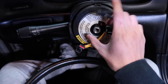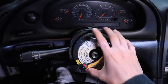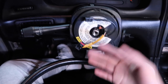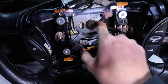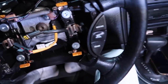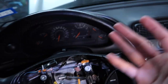To throw your new steering wheel on, same thing — pretty straightforward. Just pop it on, connect the wires, then put your airbag back on. This new wheel is already assembled so I do have to take the airbag off first, feed the wheel on, connect it, and put everything back together. The hardest part honestly is just getting the old steering wheel off. The yellow wire goes up top and this other connector plugs in first before you put the airbag on — and you're done.